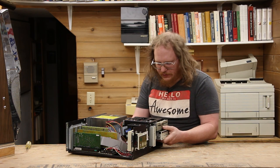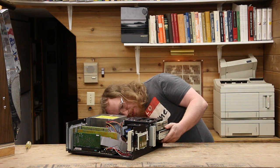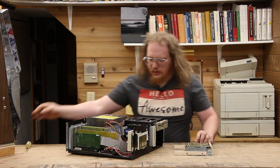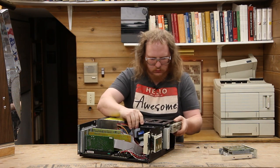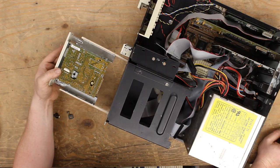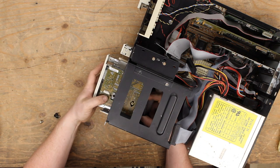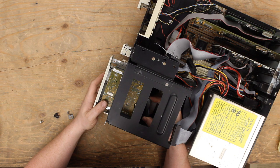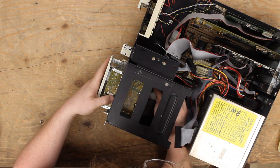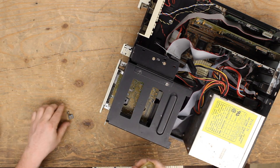Then you fight with the ribbon cable — because, genius me, I put the floppy drive on top and I can't see the ribbon cable plugging in underneath. I'll make this easier and just take that drive out. Now we can install the tape drive — that's going to go into the middle slot and just slide in. I can see through the windows and just plug in the tape drive, plug in the power, and then apply the set screws.